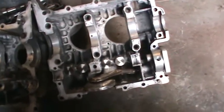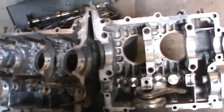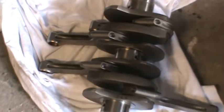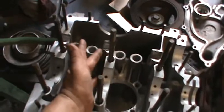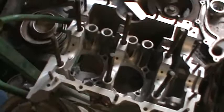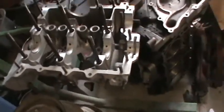I need to get it off the floor and into a stand, so I have to clean the bench up and move the big block stuff out of the way. I'm taking the 2110 out of the stand - pulled the crank out of it. There's the crank and rod assembly - 4130 crank with H-beam rods. I think this is pretty much ready to go, but I need to cut this one cam bearing off right here because the rod swings through there and hits the bearing, and these lifter bores need to be clearanced a little bit.